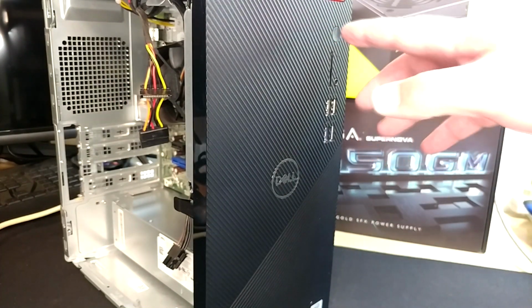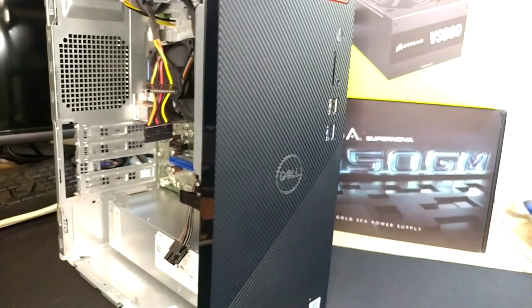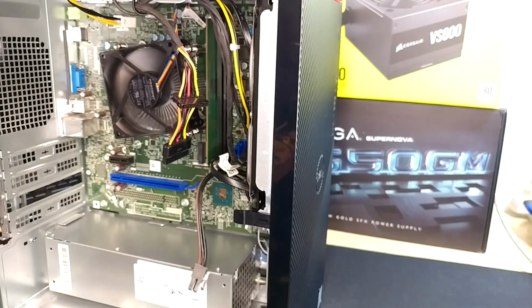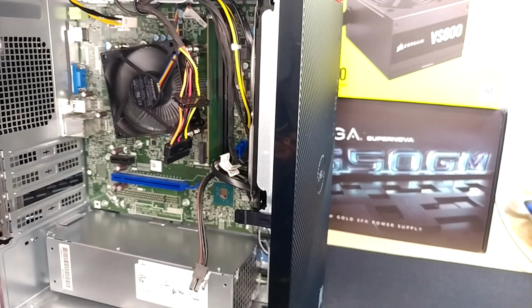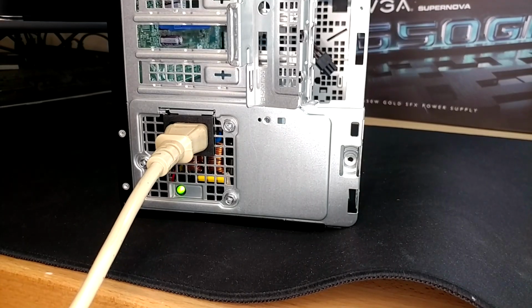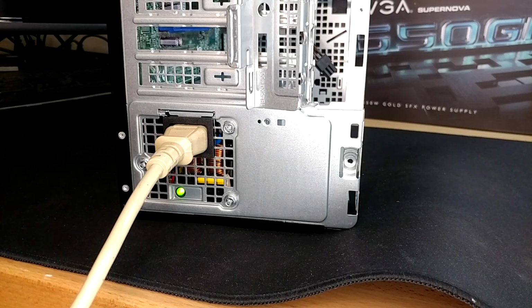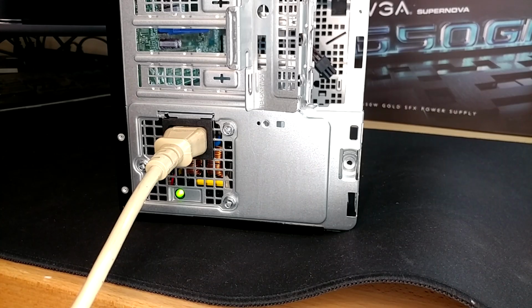I am going to go ahead and turn it on, keeping in mind there's no boot drive in it because I took the SSD out, but it is coming on. See our CPU fan spinning, assuming we've got a PSU fan spinning. Touched the steel case and didn't get electrocuted, that's a plus. The green LED on the power supply is on. All right, there you go. So the next move for me is to shut this guy off, put the rest of my hardware back on it, and we'll actually plug it in, turn it on, and make sure it works.